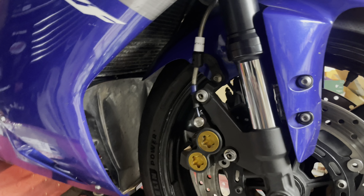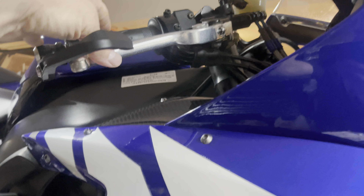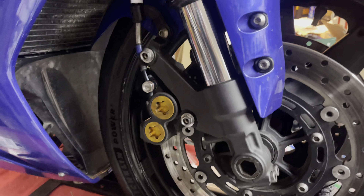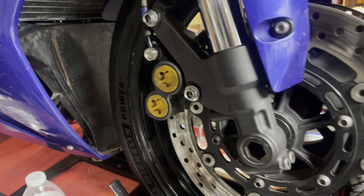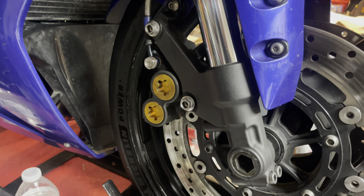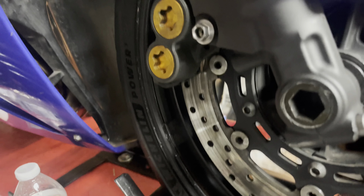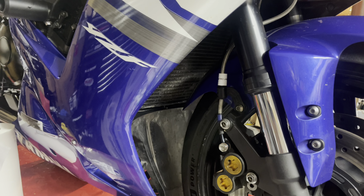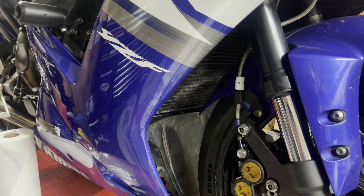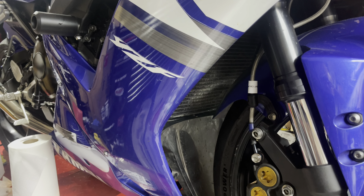Alright so this side is all buttoned up. Now just go to your brake lever and start pressing that a bunch of times — that will end up pushing the pads back into the disc and make the pistons go out. You have to press it a bunch of times and then you will get pressure on there and you are all set. If this video was helpful guys make sure you hit that like button, if you haven't already hit that subscribe button. Thanks for tuning in and we'll see you in the next one.